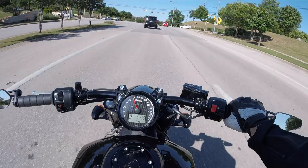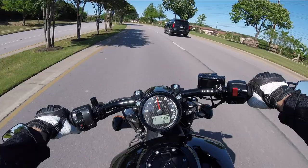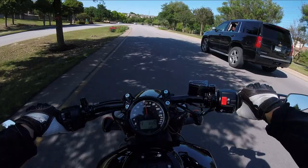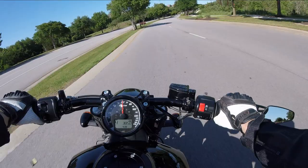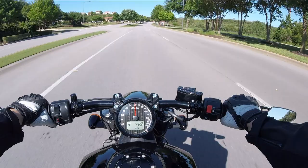So the question — will a 180 fit on my rear wheel? The answer is, people have done it. However, buyer beware. When you look at proper tire fitment on motorcycles, they're set at that specification for a reason. And with the Bobber only having a 3.5-inch width on the rim, your options are kind of slim.